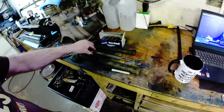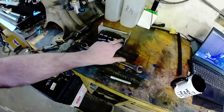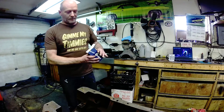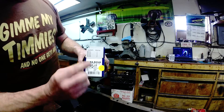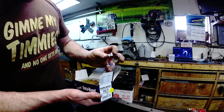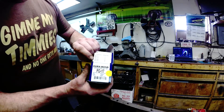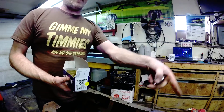You're also going to need a hammer and a 7/16 wrench to tighten and loosen the cam bearing tool. You'll also want a Sharpie. Now the bearings are all numbered for position — it comes with a little stamping part number on each one. So for bearing number five, you'd look at the stamping: PD12-5, and it's position number five so you know that's the right bearing. You have to start with the far end in first and then work your way out.